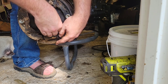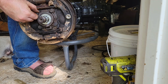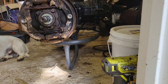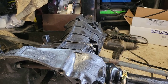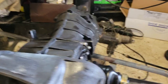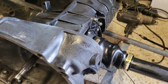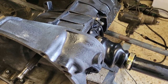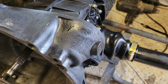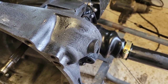Put your four bolts back in and tighten those down to 43 foot-pounds of torque. Next step would be to put the brake drum on and tighten down the axle nut — that goes on at 270 foot-pounds of torque. I'm not sure yet whether I'm going to use drum brakes or disc brakes. I'm waiting to find someone with the machine that will fit the spline part of the brake drum to see if they can be resurfaced. A new pair of brake drums is about $400, and the disc brake kit is only $100 more and comes with everything new.